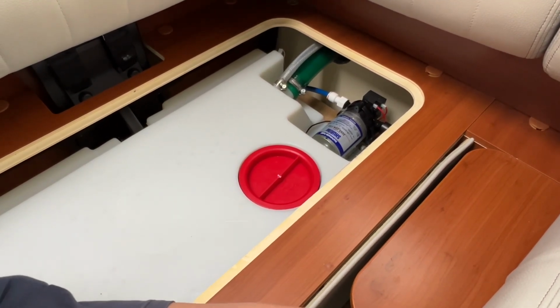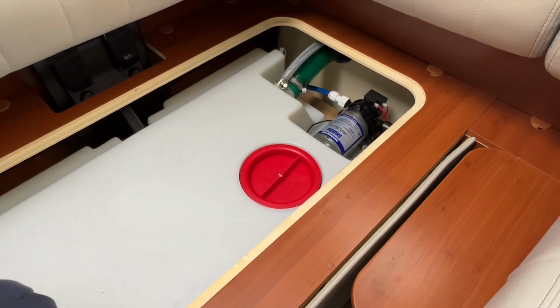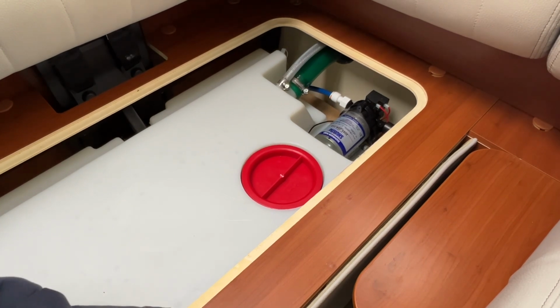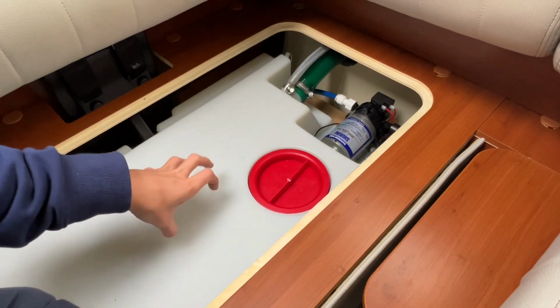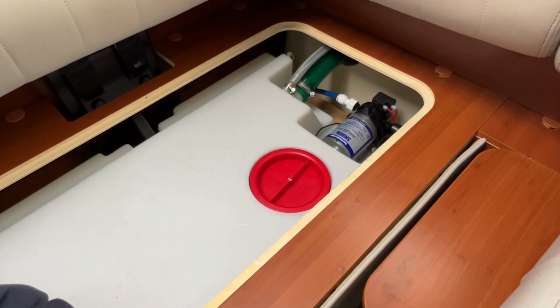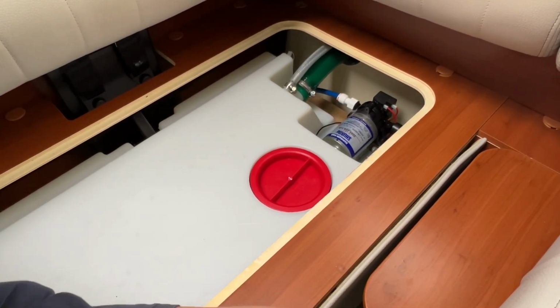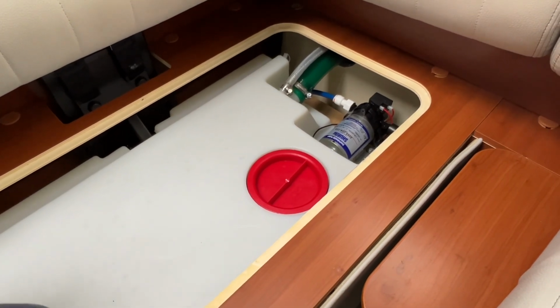It's also really important that in the winter you don't store the vehicle with any water in, because when we're experiencing colder temperatures in our winter climate, you wouldn't want the water to freeze, because it would cause problems to this tank, because it's just plastic, the pipework, the pump, and then when you use the vehicle in the upcoming season, you'll have loads of problems and you'll be wanting to try and get it repaired as quick as you can to get using it again, and it will be a costly mistake to make.